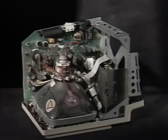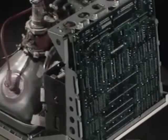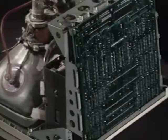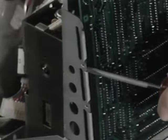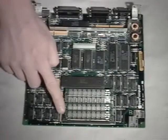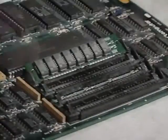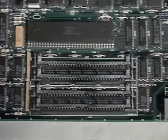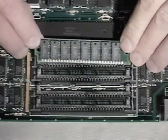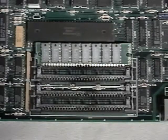Take hold of the connector near the motherboard with your left hand and put some additional tension on the cable with your right. Work it slowly and gently until it comes out — be patient and be careful. Now that the cables are removed, pull the motherboard straight up out of the frame. If it sticks, check to make sure something isn't catching against the frame. Lay the motherboard down on a padded surface with the SIMs facing away from you. Remove all four 256K SIMs. The SIM sockets are arranged in two banks: Bank A and Bank B, each with two sockets. Pick up your one megabyte SIMs and insert them into the first bank — hold the solder edge down, insert the SIM, and push it back until it snaps in place.